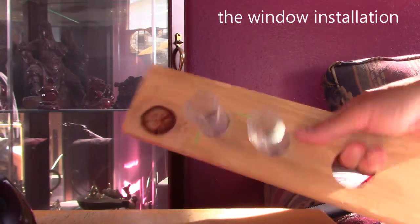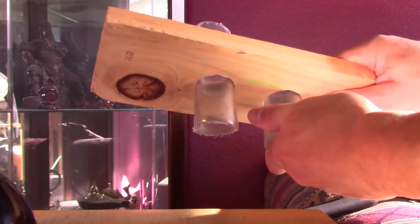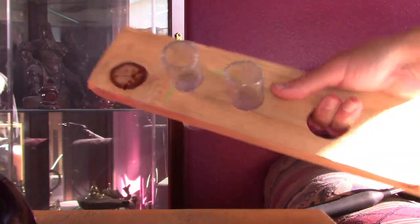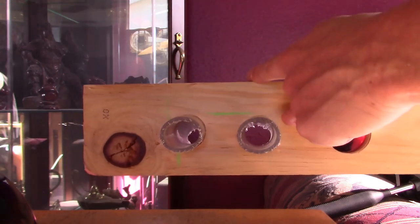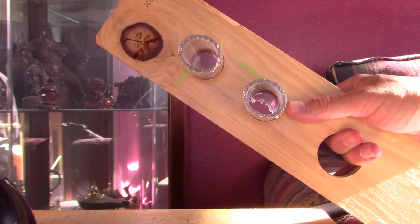For the install, just go through a window like this — put the pipes in one-and-a-quarter inch holes in a one-by-four, drop it in a window, remove the screen, and then just shut the window down on it or side-slide it, and you're set. The blue evap cooler goes outside and the heat exchanger inside.